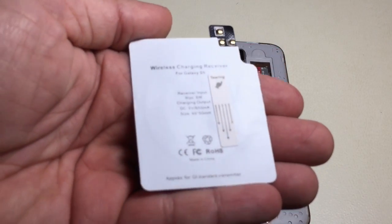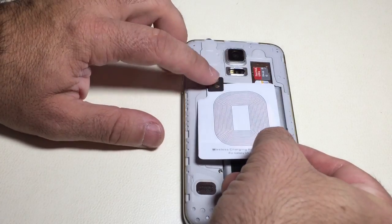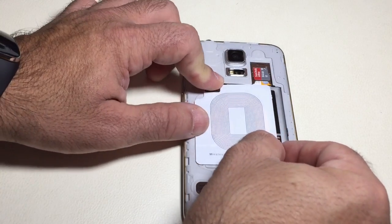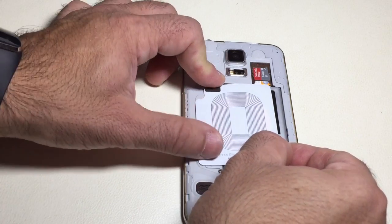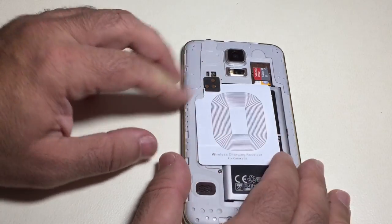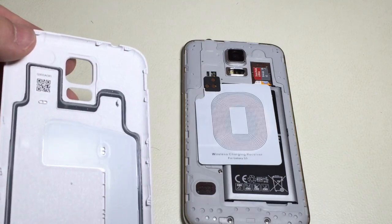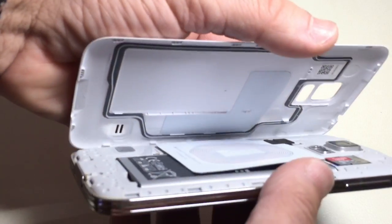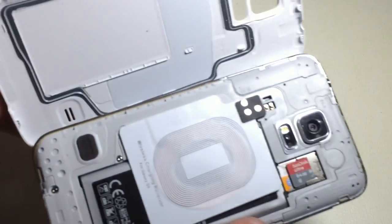We're going to be aligning them just like so and this little coil area is going to be facing up. You'll notice that there is a sticky or glue that we'll remove — that's just used to keep it in place. Making sure that this aligns here with these three points, and then once you align it nicely you'll want to keep it within the frame of the phone because the S5 is waterproof and you want to make sure that the gasket on the back does not get blocked in any way, because then the waterproof seal will get impacted. Right here the seal is not being impacted at all, so I'll be able to close this and it's going to be fine.